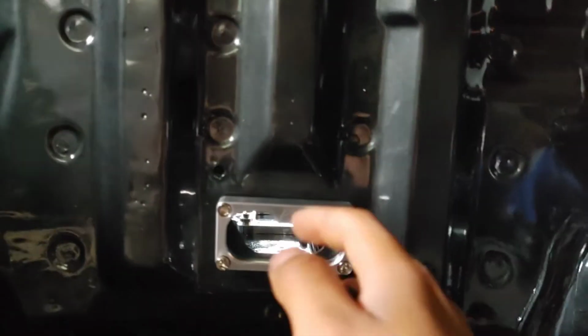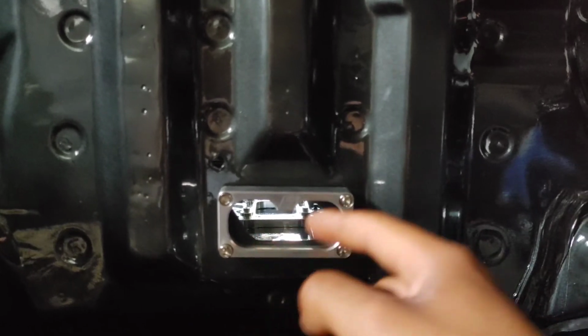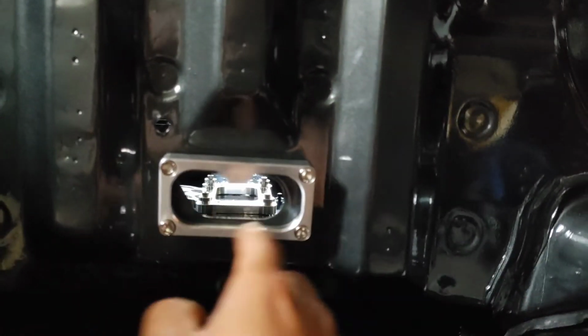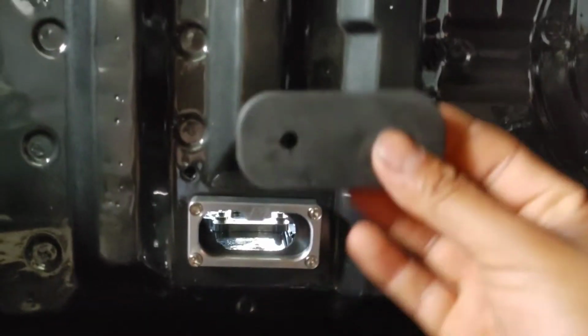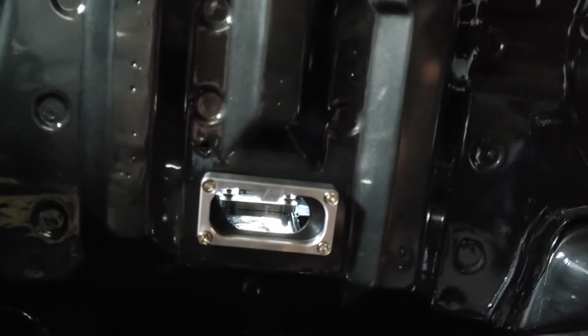And it's a new day. So, got off work. I was just going to finish up this vlog, tying everything down, and D-Wix isn't here. The reason why I say D-Wix isn't here is because I can't be underneath the car plus inside the car to tighten the shifter plate. It's a lock nut, so one side needs to hold still, the other side needs to tighten. And then pretty much the same thing with the grommet, but the thing with the grommet is I'm not running this. This would be if I just wanted to run the shifter cables, but I'm actually going to run my engine harness through here along with my shifter cables. So the shifter cable is going to be right here, and then my engine harness would be on this side. So to give it more room, I'm actually going to tape it back up, mark it, drill it out a little more, and just use the aluminum piece as a beauty piece, and just save this because who knows, might need this later on. It's still a good piece, and that's about it.